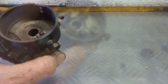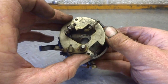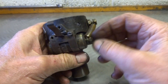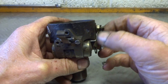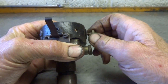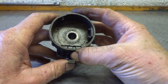There we go — base plate removed. The two screws took the whole lot out; no need to take the split pin out. The whole thing just comes straight out. The other thing you don't need is the condenser, so the condenser comes off like so. Then take off the electrode — it pushes out quite simply like so. And we're now ready to fit in the AccuSpark device.